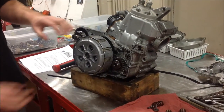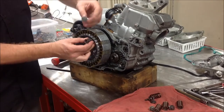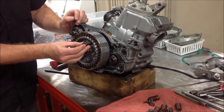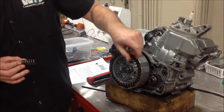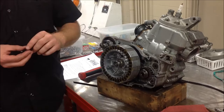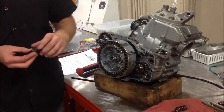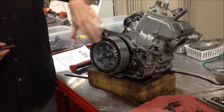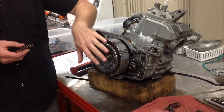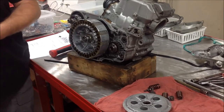So for this video, you can see we took this part off and didn't break anything. If we had all of that tension on that one part — this spring boss sits down in here, sits across there — that would put a ton of stress on it and snap it off. Numerous times over the years, I've had students overlook this, and it's the one part that's commonly broken. Skills Every Mechanic Should Know: even pressure. And what do you think you have to do on assembly? Same thing — even pressure on assembly as well, installing in a star pattern.